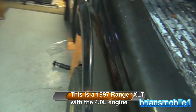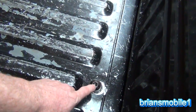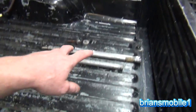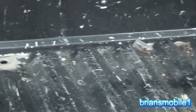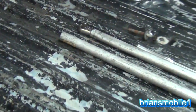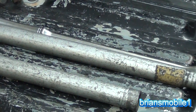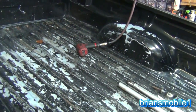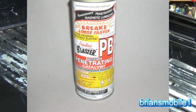I've got a chair on this end and I've got it tipped back. On those Chevy ones I did before, I tipped it sideways; on this one I tilted it back. You've got six bolts holding this in — two in the back on each side and two in the front. One up here was really hard to get out and another one came right out, plus a gas cap. I've got cheater pipes, a ratchet, and a breaker bar. These things were rusted in there — the impact just wouldn't get them. I pulled three of them and the other three I had to use a lot of PB Blaster and penetrating penetrant with the impact. It's just bad news.